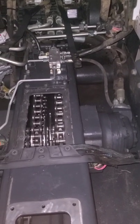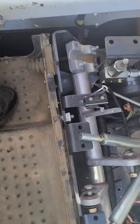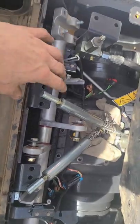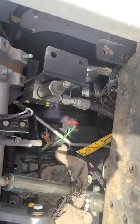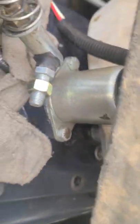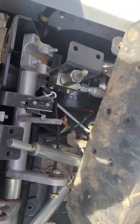Steps to putting this stuff back together: you've got this control for all your foot pedals and levers — put that in there first, just push it back out of your way, and get this foot panel in here. Get your two bottom bolts started. Your control levers are gonna go right here, and then when you get to the foot pedals they get controlled back there by that. The piece of this tray is gonna go back and forth — I'll show more when I get a little further.